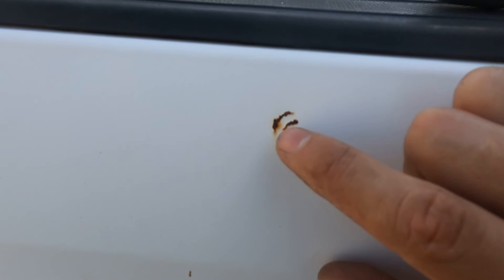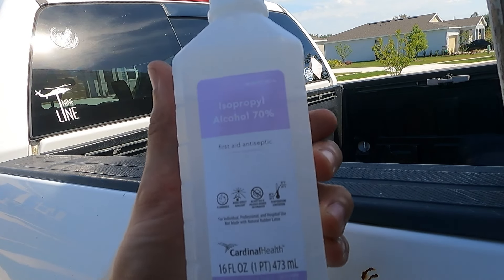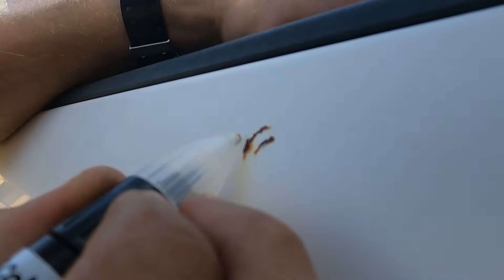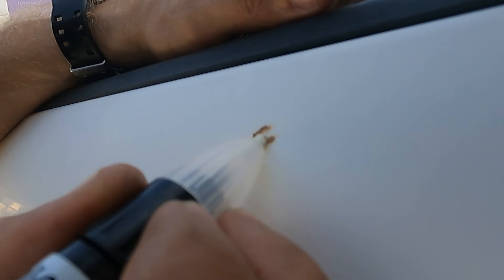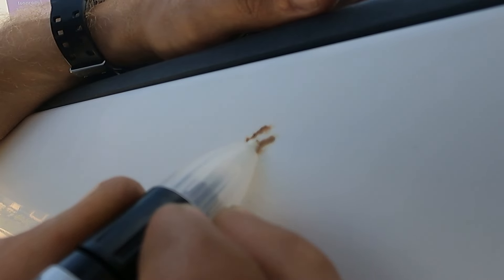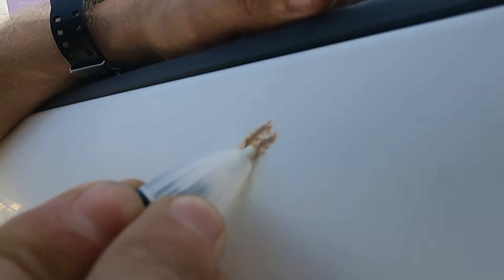I think this pen will be most effective on cars with newer paint or ones that have a shine to match — the clear coat really does give it a shine. My main goal with spots like this though is to stop rust from continuing on the truck. The only other thing I'd recommend is a bottle of alcohol and some type of towel to apply it, then use the fiberglass tip to scrub out some of that rust. Make sure to get on the rust spots but also go a little bit on the outside to smooth out and level the edges of the paint.